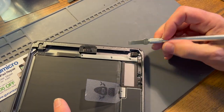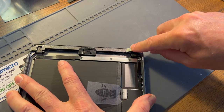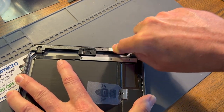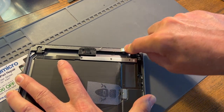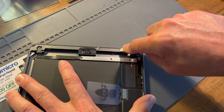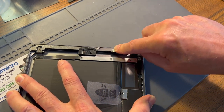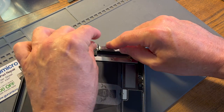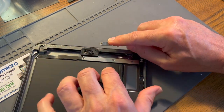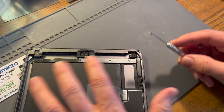You can see right there is a little fragment of glass that was stuck in that edge. Sometimes you don't even see that stuff, but it's very important to do this step because that gummy stuff — it's all lumpy and has little pieces of glass in it — that will cause your screen to fall off. So go around the whole edge. After I cut all this glue off, I'll take a durable cloth and scrub with the 91% isopropyl. Paper towels tend to fall apart — I use these pads, they're a really strong cotton mesh that doesn't flake off little balls of fuzz. After I scrape the glue, I go around and scrub again, and that surface is basically ready to go.